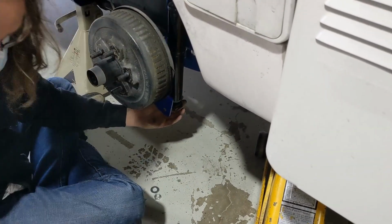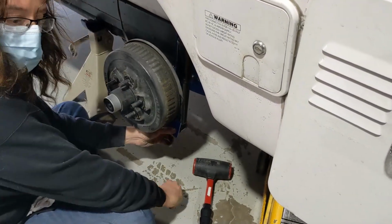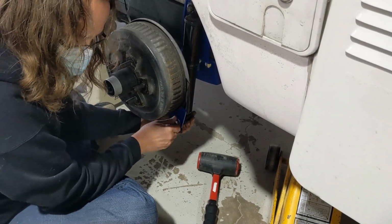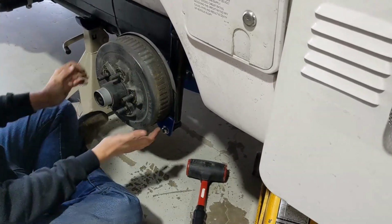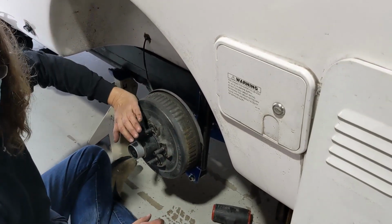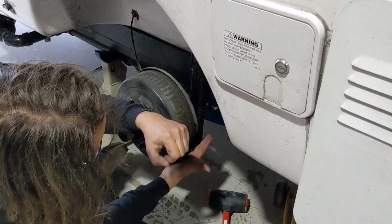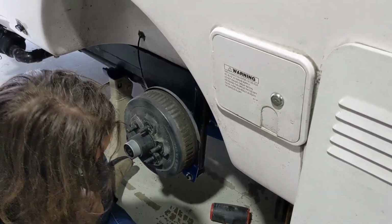So when they're brand new, the blue plate would have to come further down? The blue plate hangs further down, or I should say the spring is springier. So it's in a different location. I see. Yeah, exactly, because this axle moves, so over time it compresses a little bit. The way this works is you have the pivot here and this arm moves up or down. This part will move up and down. This part is fixed, and there we get the shock action. So that's how we get that.